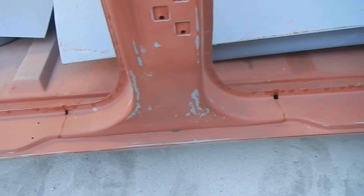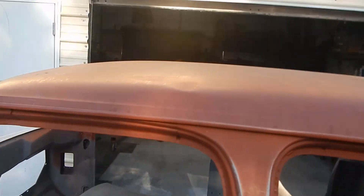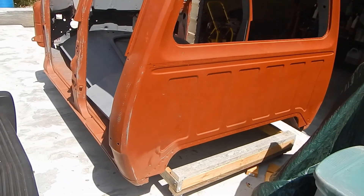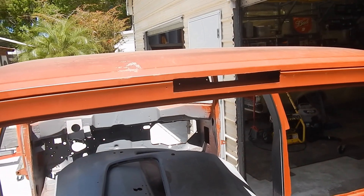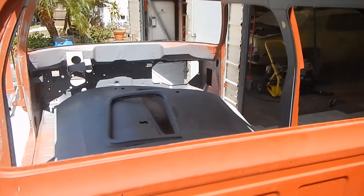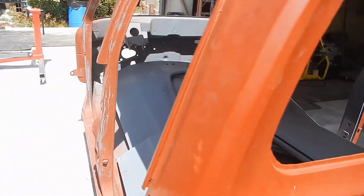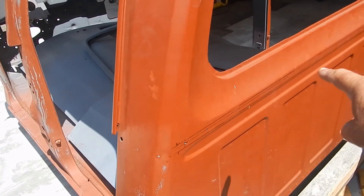They used seven sections to make up the upper rocker on both sides. It really is in great condition. Got one dent right here — somebody getting mad and popping the truck. I think every truck around has that. We have fitted it for a new style third brake light with cargo lighting. You can see we've already prepped and drilled for the cab wrap-around molding for the '84 style deluxe. This truck originally came with the stainless strip molding, but because it was not a two-tone, they didn't put this molding all the way across the cab, which we found. So we'll be showing that.